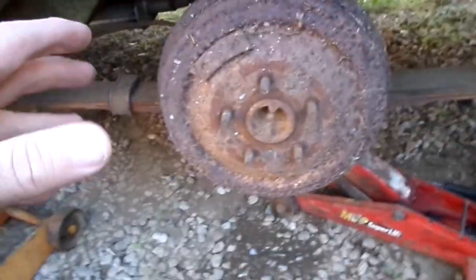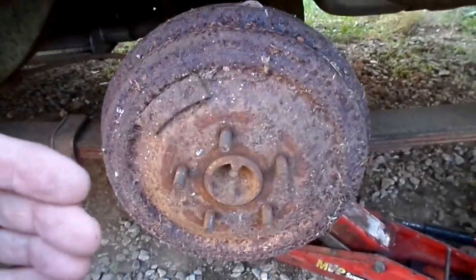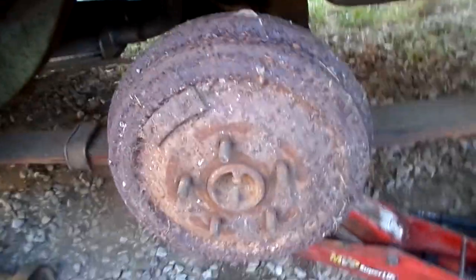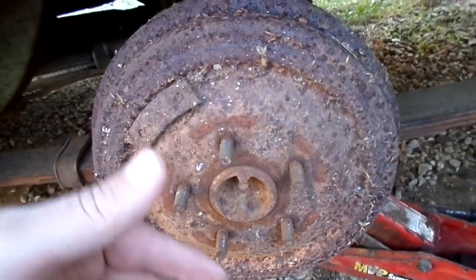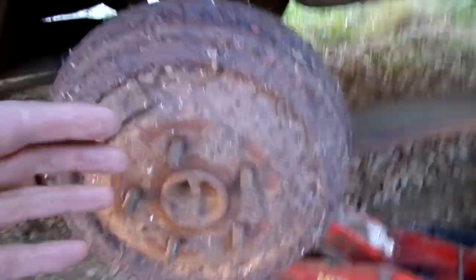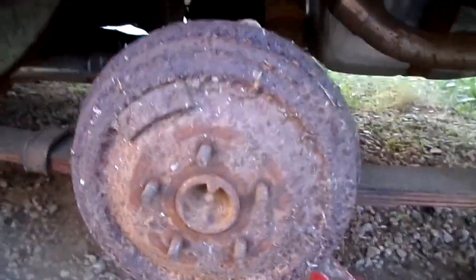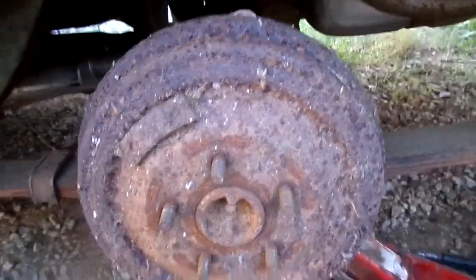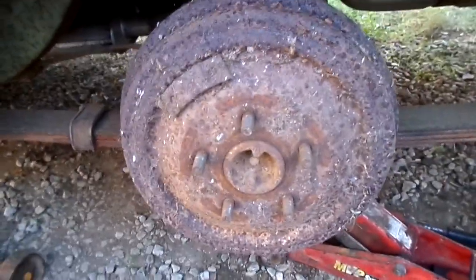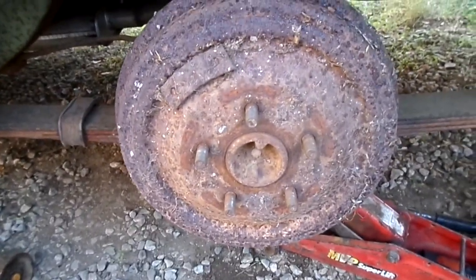This project is kind of going to be a two-in-one. What I'm doing is replacing basically the whole brake assembly. This is a 10-inch brake, and the car is supposed to have 9-inch brakes, but this rear end is off of a V8, and this is a six-cylinder car. I've already done the other side, so now I've just got to do this side — pulling the axle shaft out, the brake assembly, and the backing plate. I'm going to break this into two parts: one focused on the axle shaft work itself, and the other on reassembling the brakes — a kind of treatise on drum brakes — because there is a lot of misinformation and lack of information on working on drum brakes.